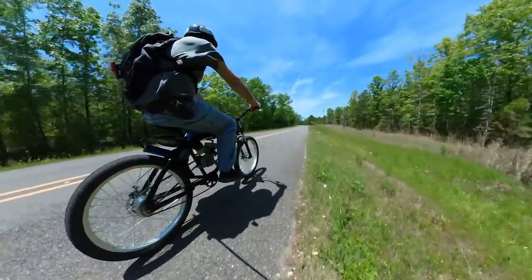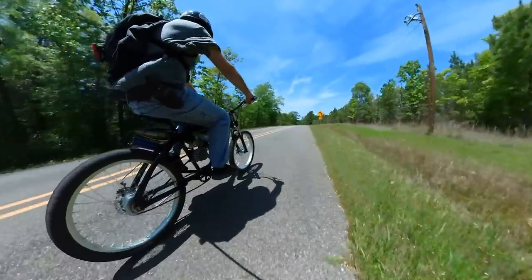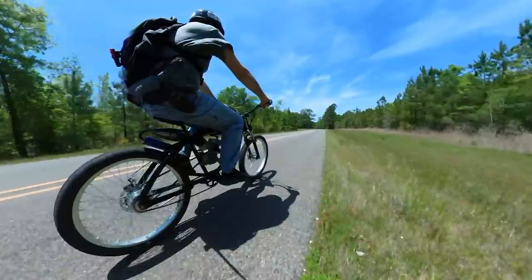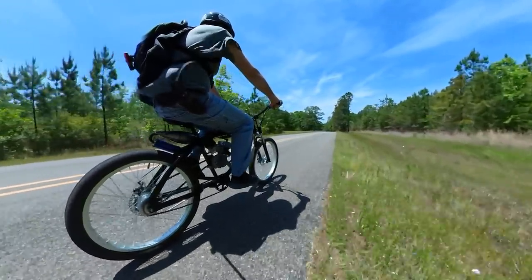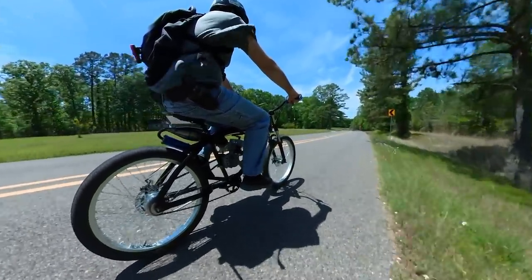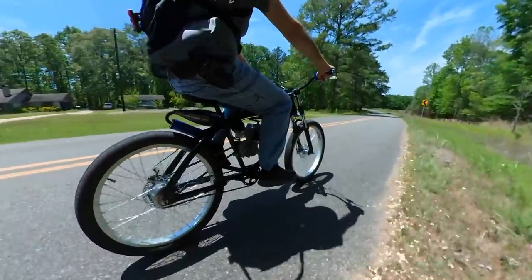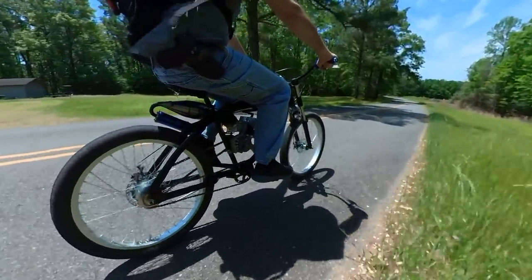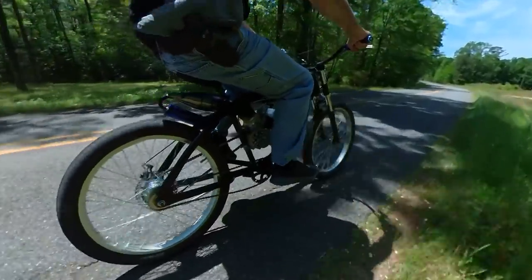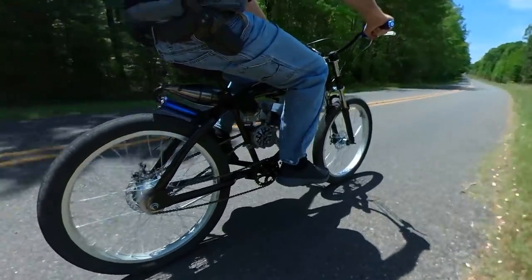I also suspect that possibly the slightly out of true crank is causing an issue with the crank seals, especially once the motor heats up. I really don't know. Every time I take a guess at something and replace a part, it still has the same issue. I think this motor's just cursed. But I don't think it has anything to do with our intake, cylinder head and so on. Although it is possible that maybe a G2 reed is just not great in my situation. So we'll be testing a different intake as well if the bottom end replacement does not fix the issue.